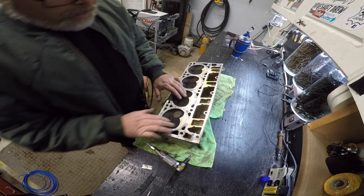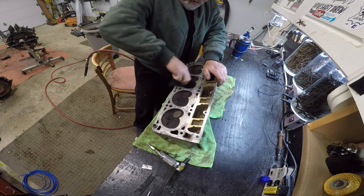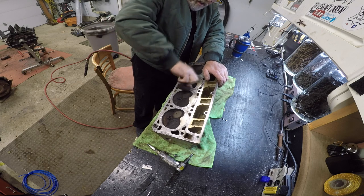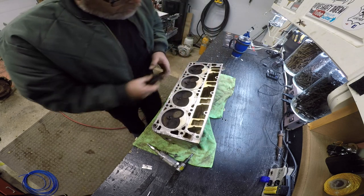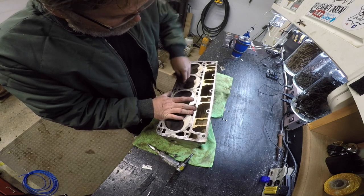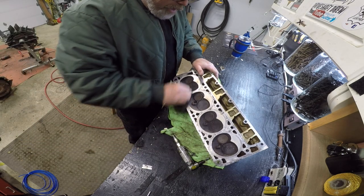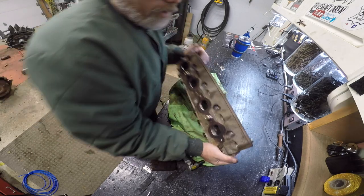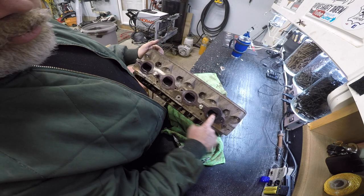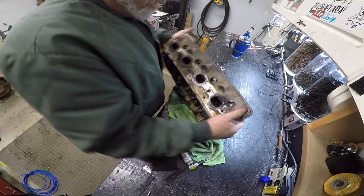I've got to finish cleaning this all up — she's a little dirty. We'll clean all these ports up. As you can see it's working pretty good just with a razor blade on the side — I'll get her a lot better than that. Clean up all these, clean up the spark plug holes, get rid of that. Check the valves while I have the springs off. We'll clean all the valves. Like I said it's just a budget build so we don't have to get carried away and they look pretty damn good to be honest. I'll show you in a minute — there's just one slightly cleaned up and it looks fine. I'm going to clean all these up and do more porting tomorrow. It's a little rough in there right now but I still got to smooth it out. The top part where it flows out on the exhaust — we'll give it a little bit more instead of such a steep angle and she'll be port matched to the factory exhaust manifolds.